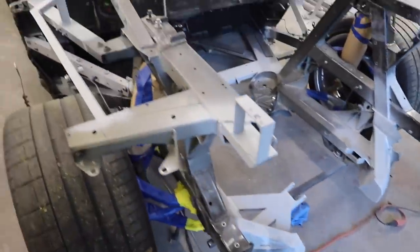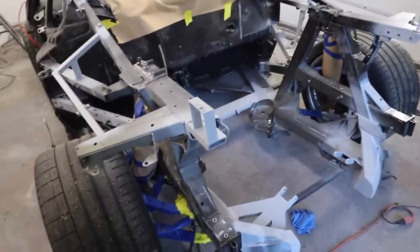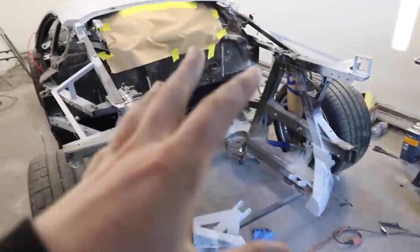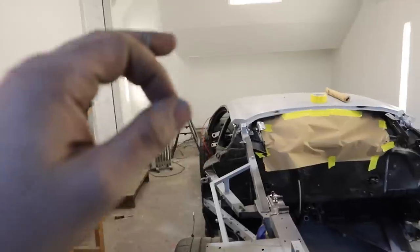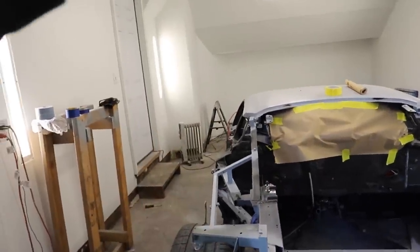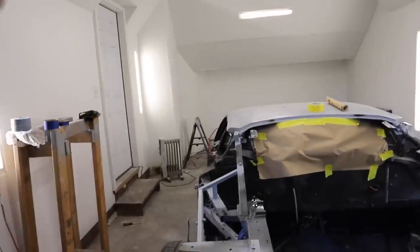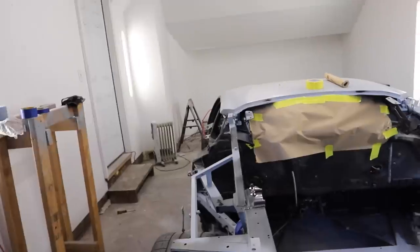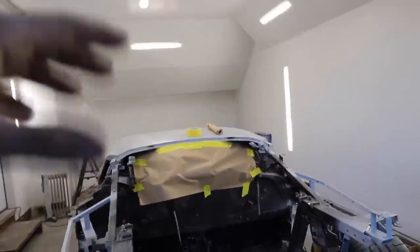Primer's on the car, it's looking great, I've got some stuff masked off and I'm ready to go. You'll notice not everything is masked off — we even still have the donor wheels and tires on here. That's because I'm using my turbine sprayer system, which has very, very little overspray. It's called the Maximizer — it's in another room and it compresses air using turbines, so it doesn't create moisture in your lines and you get clean, good-temperature air.